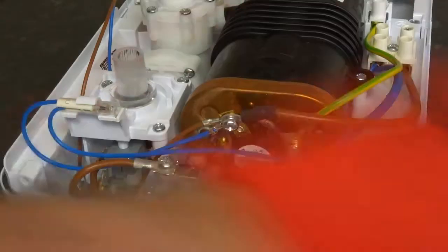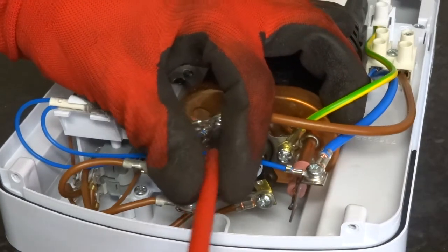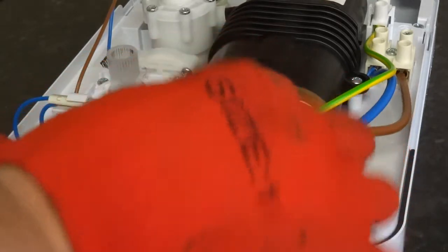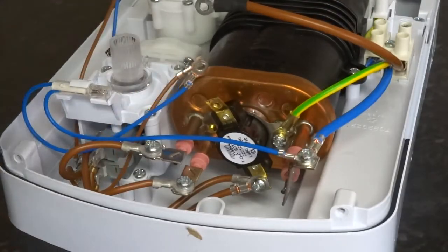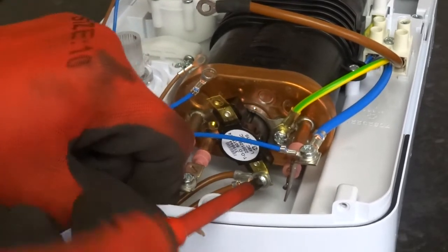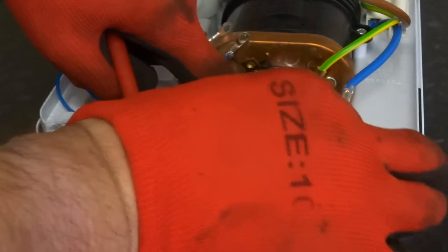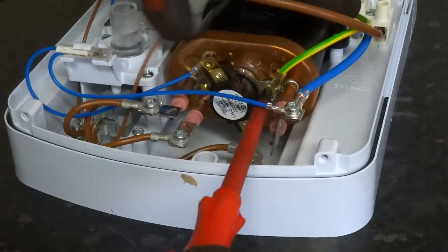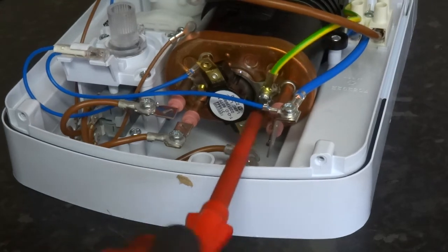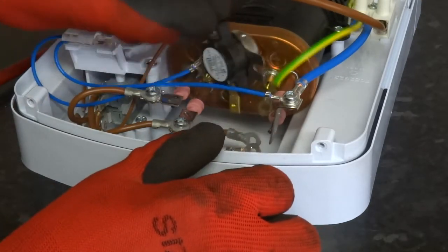But to replace it, I'm going to have to tuck these top wires off. Make sure you don't mix up the top and the bottoms - keep them to one side. The bottom ones are all tucked underneath. And the earth, which earths the heat element - the screw that holds that in actually holds in the thermal cutout. So it just pulls loose, you pull it to the right and it comes out.